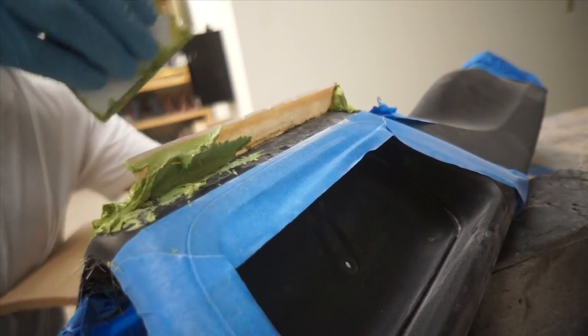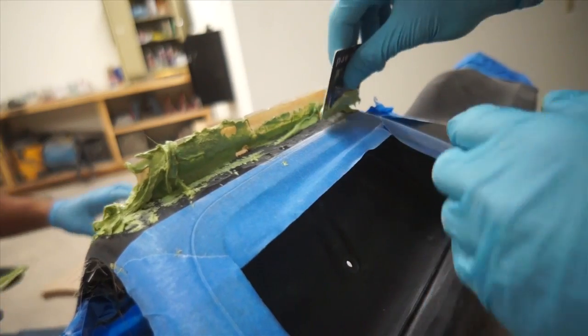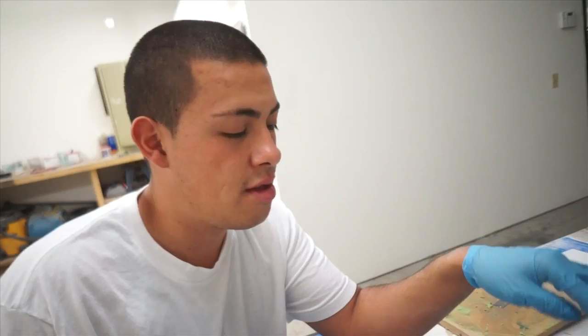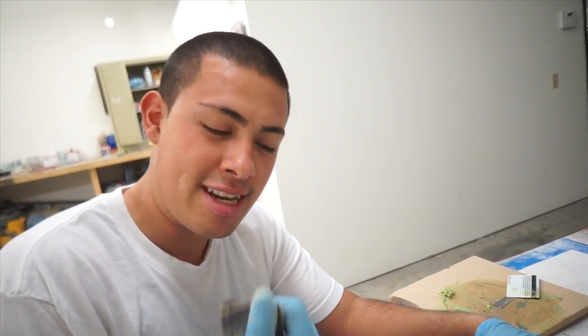Let's put the rest of my bondo in the middle. Oh bro, not so much. That's dry — get this thing out of here, get that worm out of here. It is dry, it's good. When you're sanding a lot of bondo like this, you want to use a lightweight filler like Rage Gold, because it's very easy to sand. The crappy filler is a little bit harder — kind of like my Mexican enchilada — and it's a little bit harder to sand, so you're going to be there for hours and hours to sand.